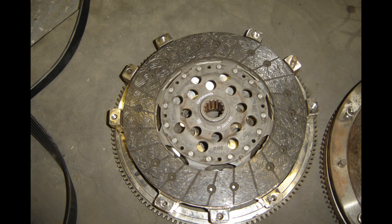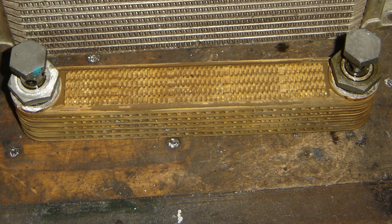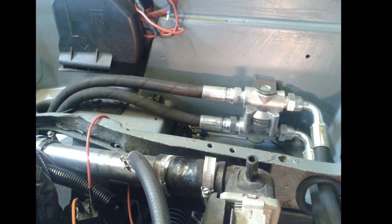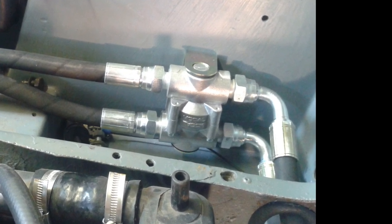That clutch subsequently lasted about 15,000 miles, but I've now found the big one — same diameter but with springs in it. Another supporting modification: in the top of the engine block there was an oil-to-water cooler. I removed that and put a big 19-row cooler at the front with an oil thermostat, so it would not flow to the cooler until the engine was warm.